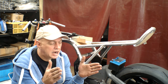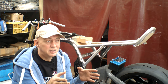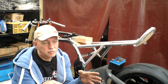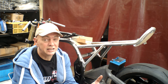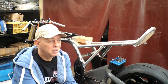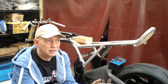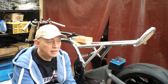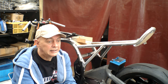An English wheel is supposed to be absolutely rigid. I might even make it out of I-beam. I haven't decided yet, but that is as tough as it gets. I built a hydraulic roller tube bender, and I did that out of I-beam, which isn't that expensive. If that's strong enough to hold up, I mean, they stick them above garage doors and stuff in houses as lintels. They are solid. So I might use one of them, or I might just get the chunkiest, thickest wall box section that I can get and use that.